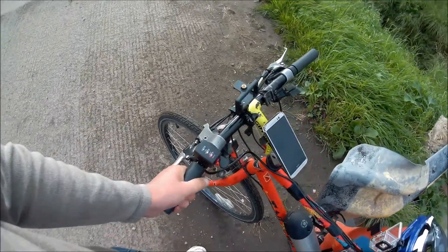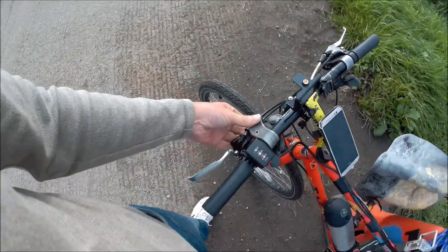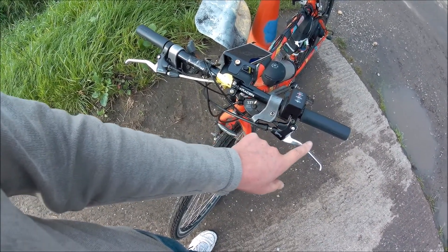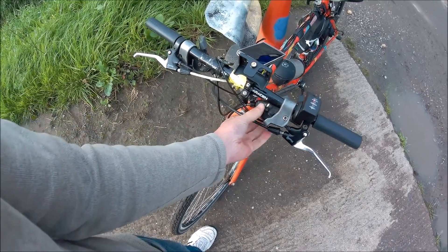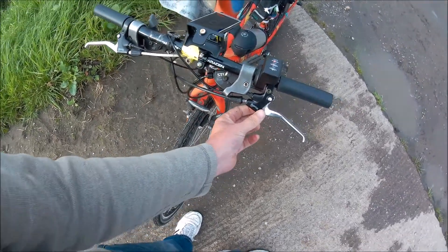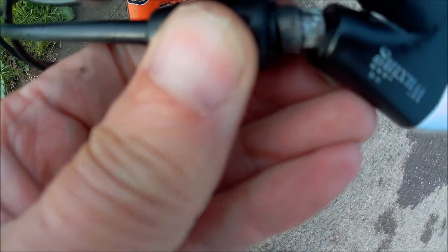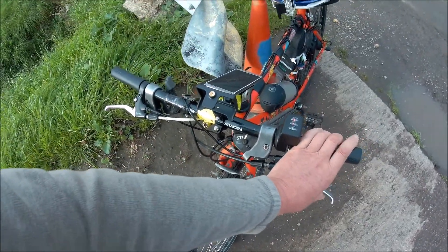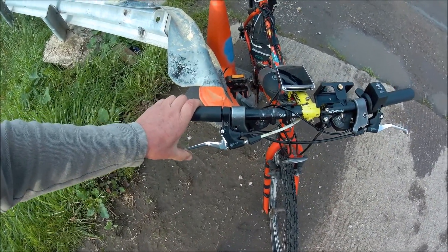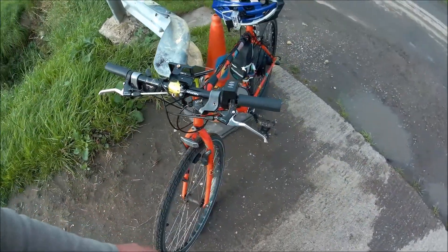Fitting it at this end, you've got to take your original brakes off. My brakes and gears were all combined, so I've had to leave part of the brake on. The brake cables don't fit into these new brakes very well — that doesn't fit in properly — but the brakes do still work. I've only got block brakes that work on the rims, no disc brakes, but they work fine. There's also supposed to be a little actuator in there that cuts the motor off.